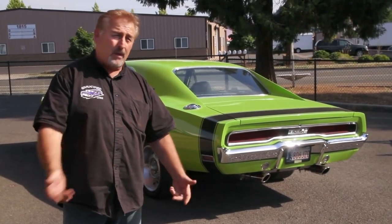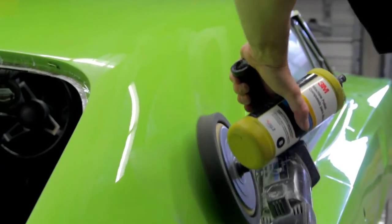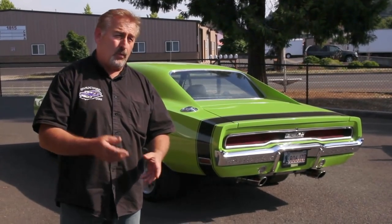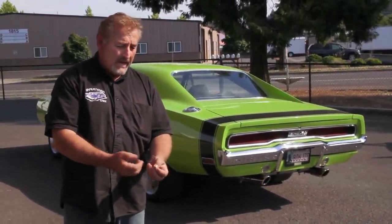It took a hard hit. I'm proud of the bodywork they did on this car — these cars are hard to get flat. They're brand new quarter panels, but they're not perfectly flat when we get them from Auto Metal Direct, so we have to make them flat. There's good body fit, good flat panels, good alignment, nice paint work. It's cut and buff back to original show-type setup because it had been a cut-and-buff car before. The rear floor had been sectioned together. We had a pile of scrap metal three feet deep showing all the sections of putting this car back together before we got our hands on it. The car had a left center punch that separated the floor from the outer rocker — it was that hard of a hit. Nobody replaced the window regulator, so I donated a used window regulator to the left quarter. None of that was part of the loss, but you assume some of that when you start doing collision work. This is a great guy who was really patient with us — all he wanted was his car done right and back, and that's what we did.